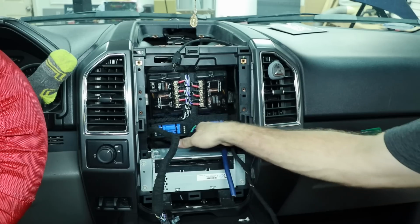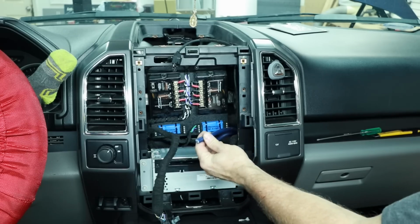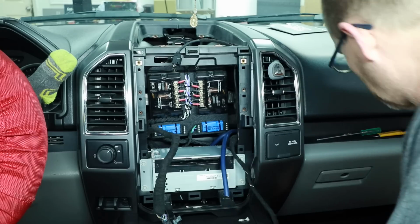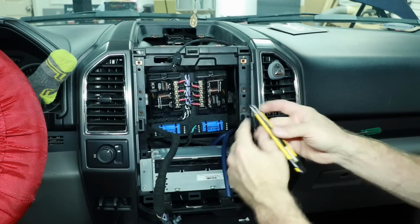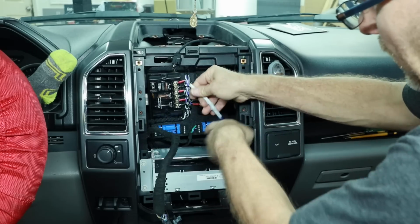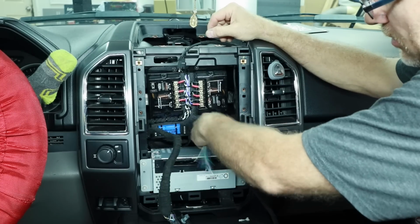So what we've gone ahead and done is soldered up the connections for our feed. What we have left to do is this here needs to be attached to our plug in order to feed the amplifier. To strip this wire, what you want to do is put your razor knife at the smallest setting that it can and just go into it and pull it back. Then get all the paper off, of course. I'm gonna go ahead and twist these together.